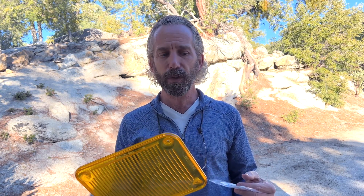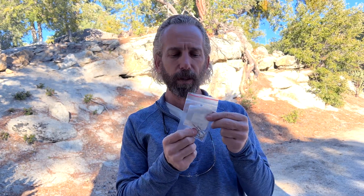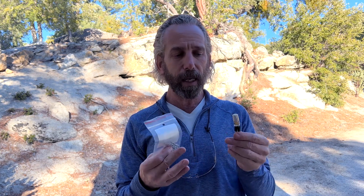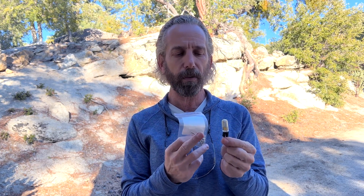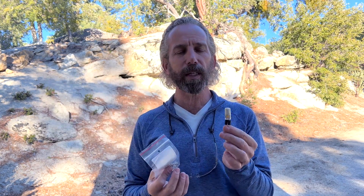Maybe I'll just try something first, and this has been really successful. What I did is I bought these little pins — I'll give you a link below the video — and then I bought these DC LEDs. This one was a 3 watt, and I also bought some 5 watters to play around with. So we're going from 60 watts to 3 watts, which is a significant savings of energy — you can leave the doors open. The 5 watt is probably close to comparable to the 60, but I just wanted some dim lights outside. For the door opening and closing, I just needed something simple.